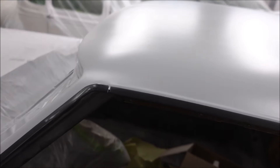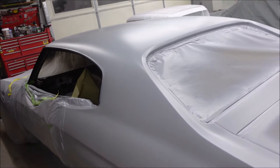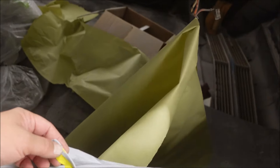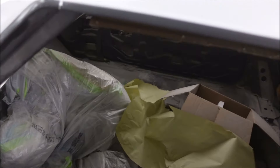Here's a little tip: mask off your drip rails. If your car has stainless drip rail moldings, don't spray poly on them because it makes them too big - then to get the moldings on you'll have to shave it all off with a razor blade, and you'll have bare metal spots and chip paint when you put them on. Also, unmask it while it's still wet, because if you let this dry it doesn't flex and it's a real pain to get your tape off.